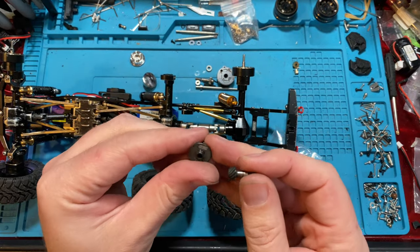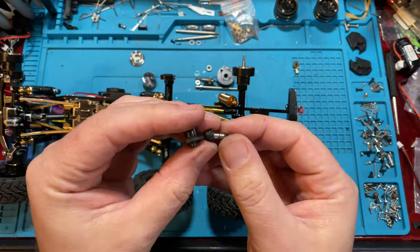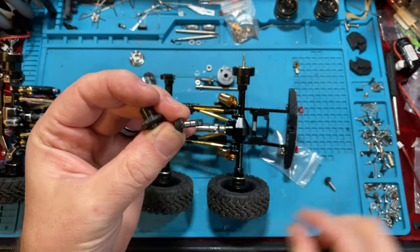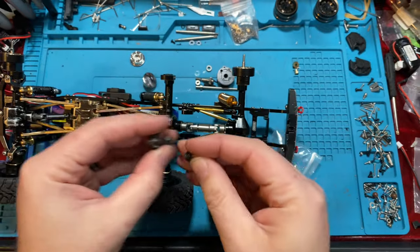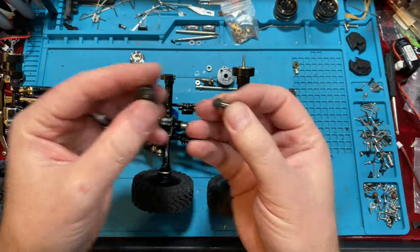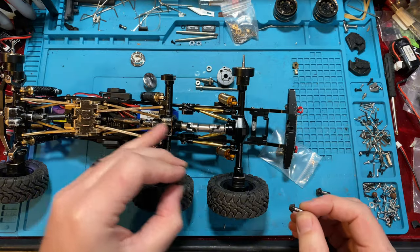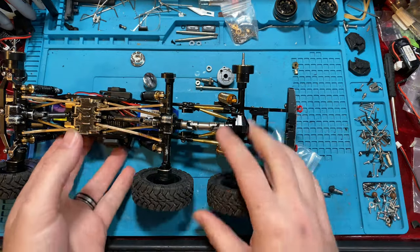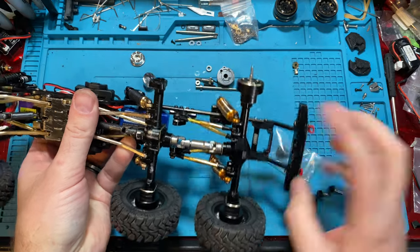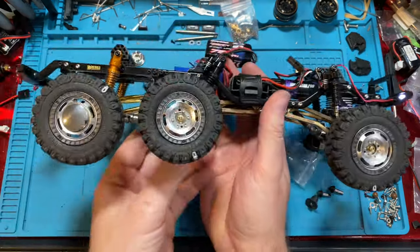We're running a 24T ring with a 10T pinion. Yeah, this one's a 10. This one's a 12. So these are 24T, 10T. So 24 10s. And we have them on the 10s on the front and the back. So you would assume that the output's going to be the same, right? But because this gearing is different, it's creating an underdrive slash overdrive situation.